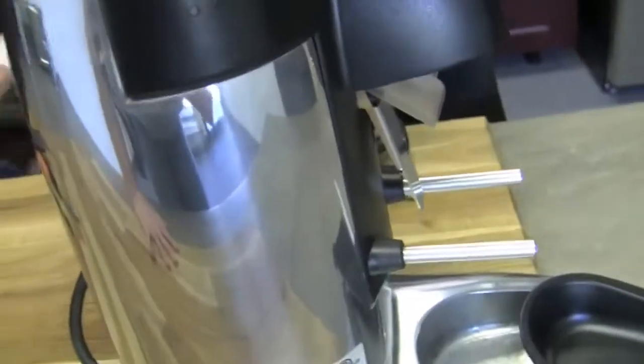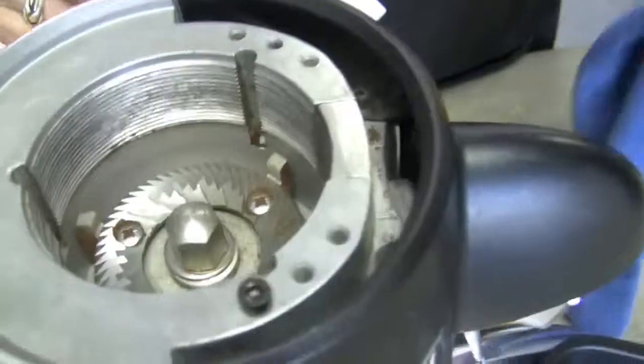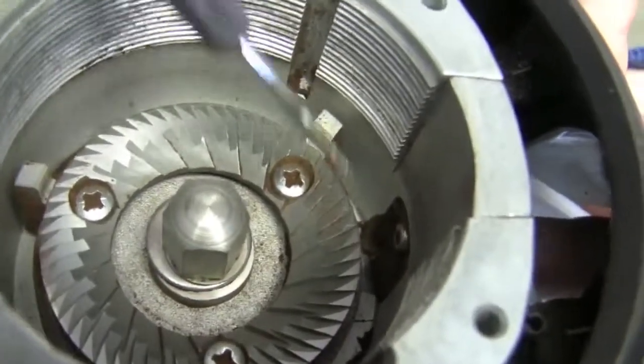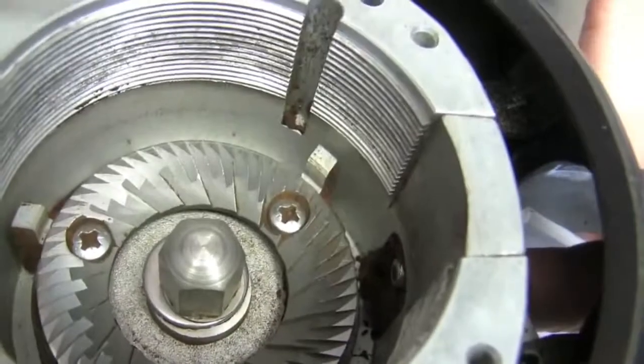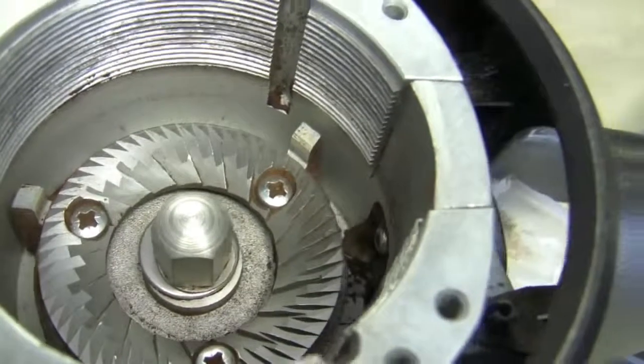This doesn't have a little hopper for the ground — do I need to do anything with this chute? Before we filmed I was looking at it; it had a little residual and I cleaned it out, just generally wiped the thing down. If that was all clogged — see my finger going in? See down in there? That's where the ground coffee goes through; there's a little rubber dam there. You could get the brush down in there and vacuum it or use compressed air as well.